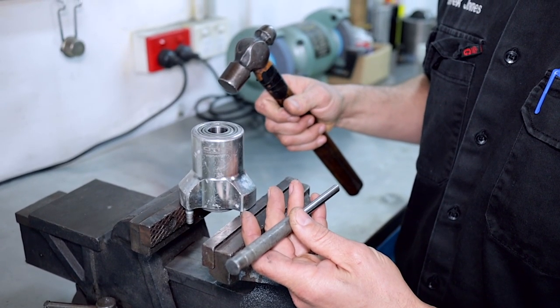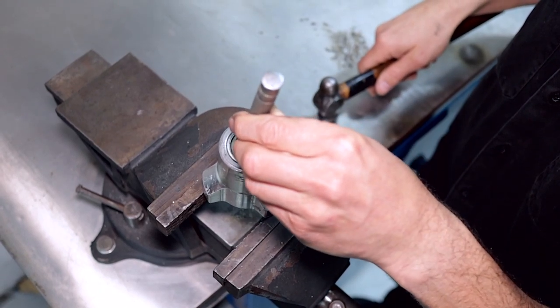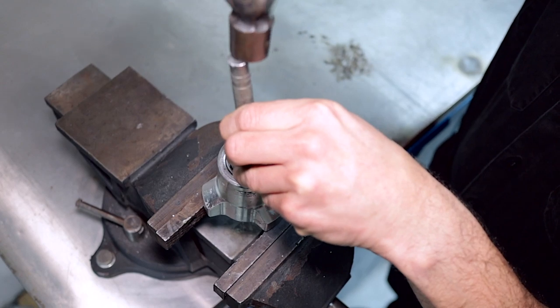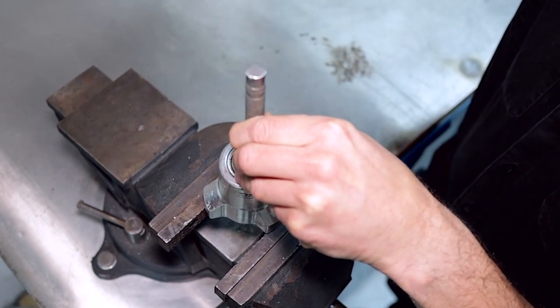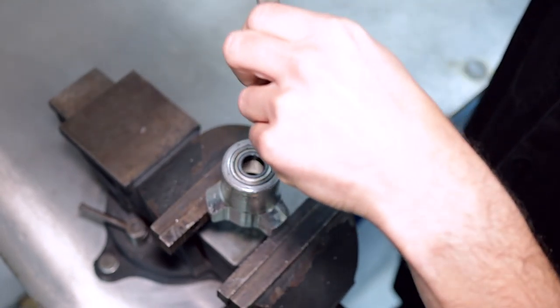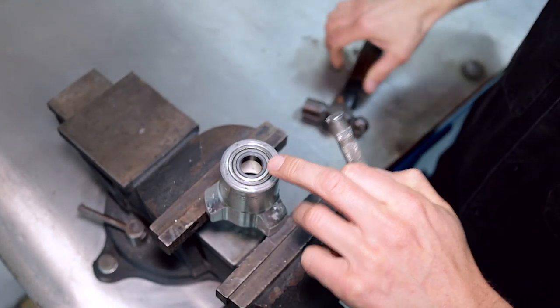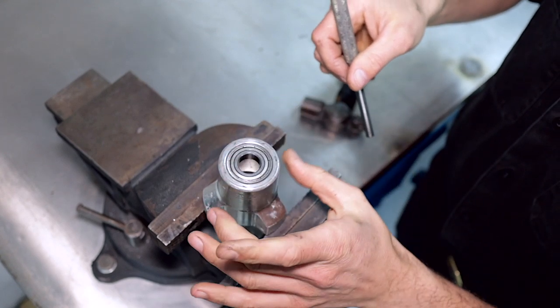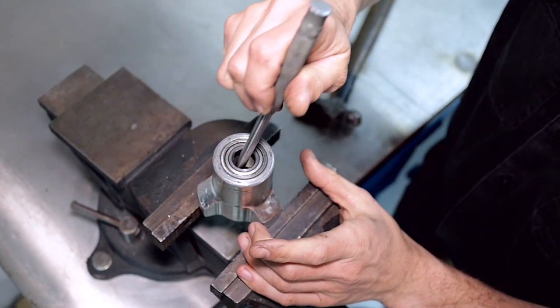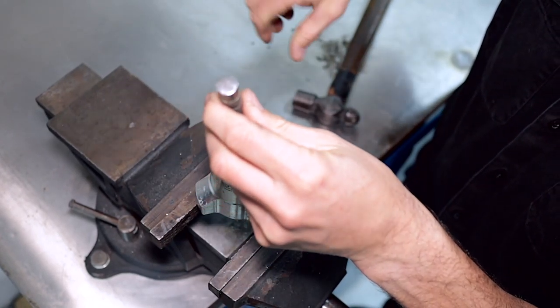out the old bearings. So now you're going to insert the pin punch down through this bearing and knock the bottom bearing out. Now, what you want to remember is that it's a pretty tight fit, so don't just slam one side of the bearing, otherwise the bearing's going to cock over and damage the housing of the magnesium. So just a couple of light taps this side, then that side, then that side, then that side.